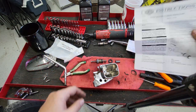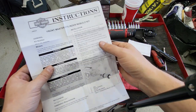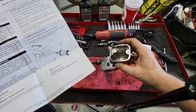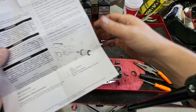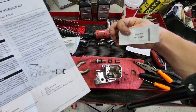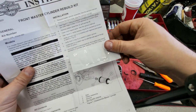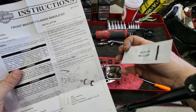Verify the O-ring is seated in the piston groove — that's once we stick everything in. It has to be there; there's no O-ring in there yet. Using the lubricant in the parts kit — that's this motorcycle lube — thoroughly coat the outside diameters of the primary cup, backup ring, and O-ring, and coat the master cylinder and piston bore.